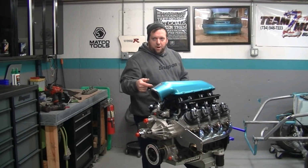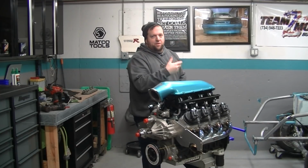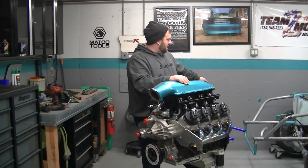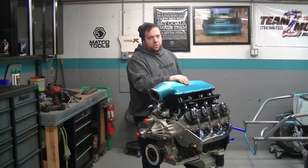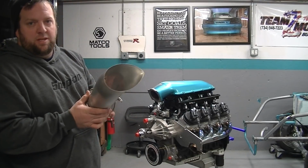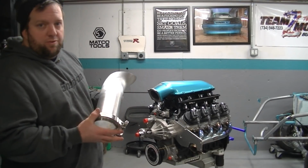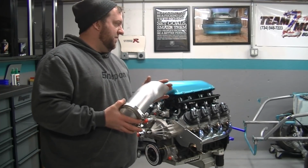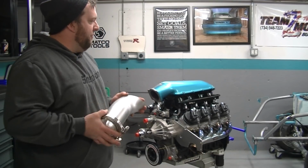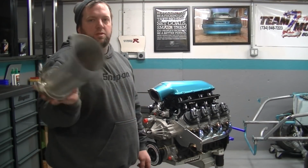I'm going to start doing the downpipe, because I'm going to have to weld a hanger on the far side. I can't have the whole downpipe just supported by the turbo. So it's going to loop under this frame rail and go out that side. When I start to do that, I'm going to have to mock up the fenders and the bumper just to see it. If you guys paid attention, I welded the V-band on this, but this is my exit for my downpipe, which is going to be out the passenger fender over there. That's because driving on the highway, it drones so bad right in the driver window. So it's going to move forward to the tire and go out the bumper. That's what it's going to look like coming out.